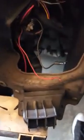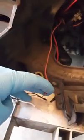That plugs into this part of the driver, the black and red. So it's black and red that matches up with the black and red. And then the rest of the driver, because I have two strips in there, I wanted to make sure they're getting the same amount of voltage or everything else that it needs. So I bridged together both of the whites and both of the blacks are here. And the white one actually goes together with the red. So connect the white with the red and the black would go with the black.